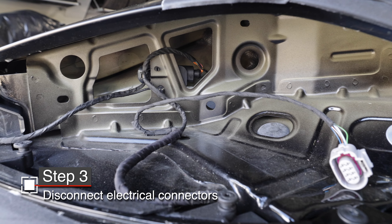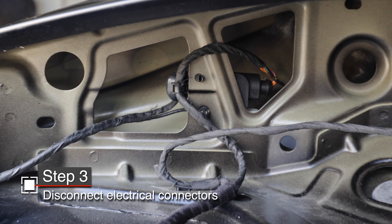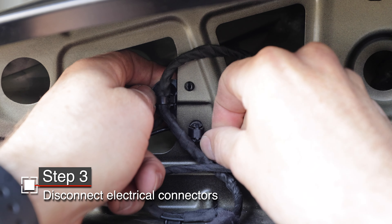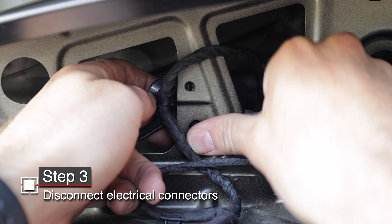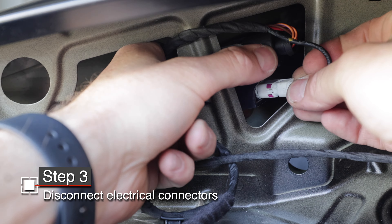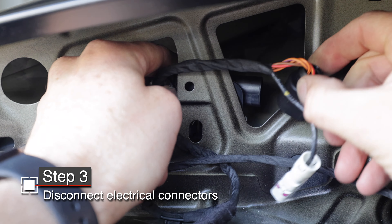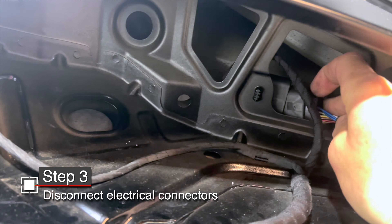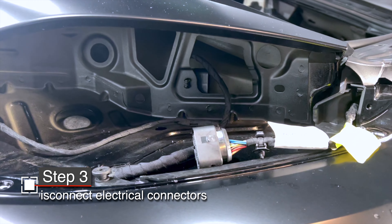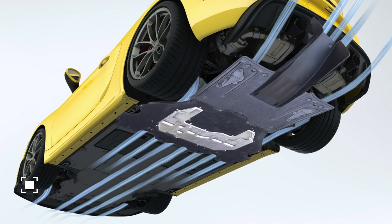While you're here, you need to disconnect some electrical connectors. Take a picture of what this looks like. Pull the black connector and the white connector off — first unclip them from the metal frame, then pull them out. These feed lights like your license plate lights and side marker lights. On the driver's side, there's also another black connector to disconnect. If you don't disconnect these, the bumper won't go very far once you pull it off.